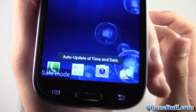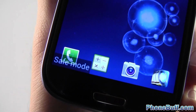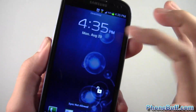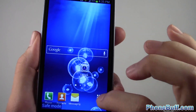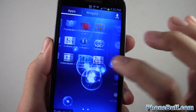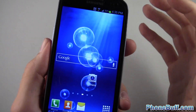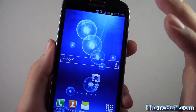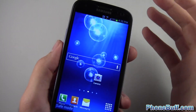You can see at the very bottom left it actually has a little piece of text that says safe mode, which obviously means I'm in safe mode. I'll go ahead and unlock my screen and you can see my widget is gone, my application shortcuts are gone. I go into my apps list and I only have two pages — the ones not showing up are third-party applications that are not essential to Android running on your phone, and this is what really helps you troubleshoot.